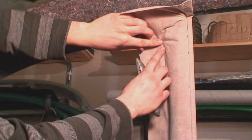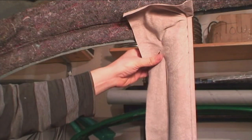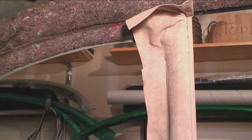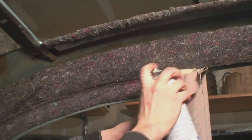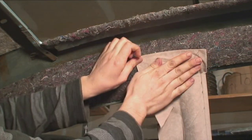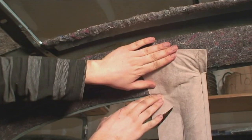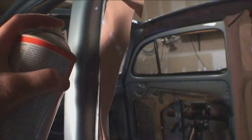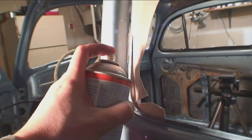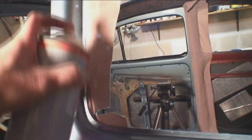Same over here — you're going to need a relief cut in the corners. It's usually where it gets all rounded out in the window areas. Just cut straight down; you can make a few more. It helps getting the wrinkles out. The top area is not too much of a concern because you're really not going to see this part — you could even cut it to a degree because you're going to have a fold and tuck over there at one point. For now you can just glue it up there. Here's the outside window area that you're going to have to glue — the headliner will get wrapped around to it. Let it set up and get dry, and then you pull it.